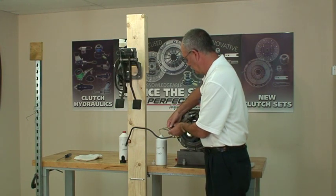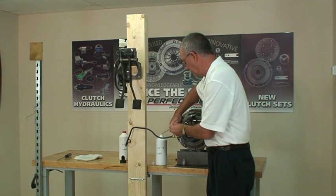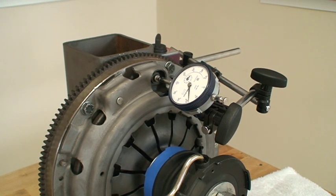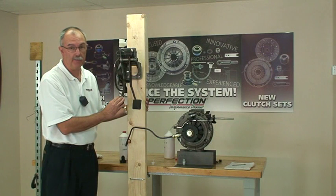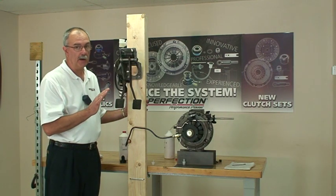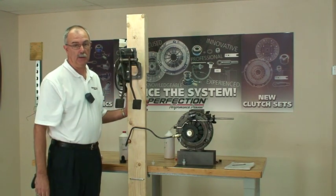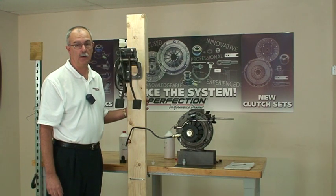Remove the drain tubing and set the used fluid aside. Now we're connected and gravity bled. You can check the reservoir level right now. Let's go ahead and release the clutch — push down on the clutch pedal, get a nice firm feel. And there it is — 60 thousandths pressure plate lift off of the disc. This clutch will release; you can shift it with ease. You can bleed the Ford Ranger and Mazda series of trucks, not a problem. Once you understand these basic steps, check your work and you can tackle this and beat it. If you have any other questions or challenges about this clutch or any hydraulic system, please call Perfection at 800-258-8312. Press extension 4 when you reach the computer answering system, and Tony or Steve will be glad to take your tech call and help you out.